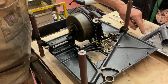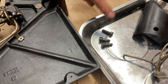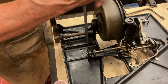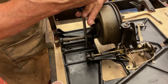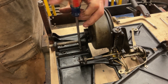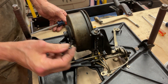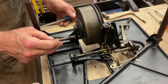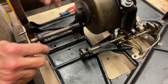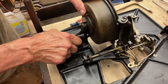You notice when you take them apart you have a short one and a long one — you need to remember where they go. The long ones go to the front, the short ones are alignment. The long ones go in the front, meaning closest to the spring barrel. And you just jiggle that out.